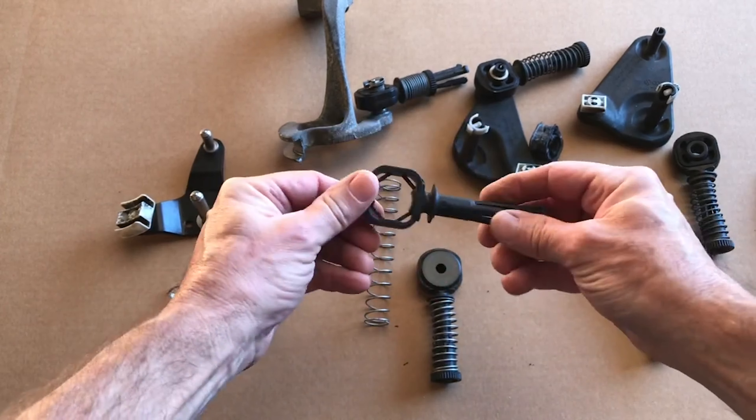Once you've located the double tooth, line it up with the double keyway in the front-to-back, which has a little divot that faces the cable end side of the front-to-back bracket, and just drop that on. Sometimes this little boot will be covering some of the threads — if the cable end doesn't want to go on far enough, just force that boot back to the firewall and make sure all the threads are exposed. Then take the 8 millimeter lock nut and thread it on and tighten it — it'll click into gear as you start to rotate, and that's fine.